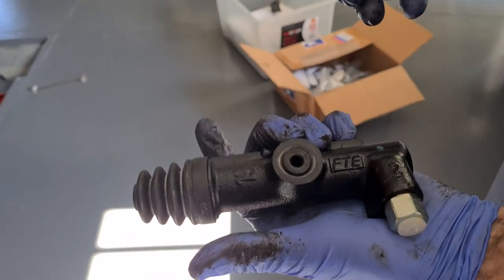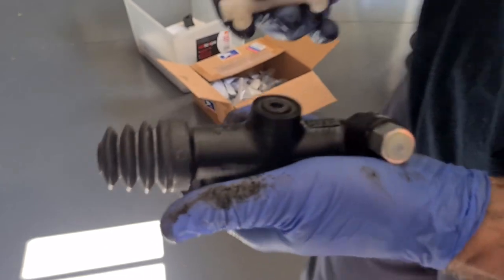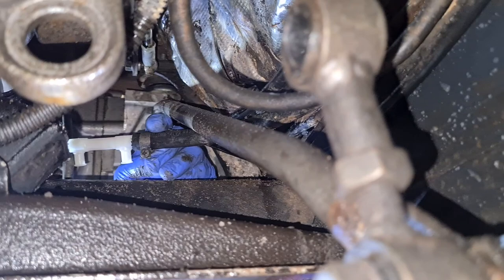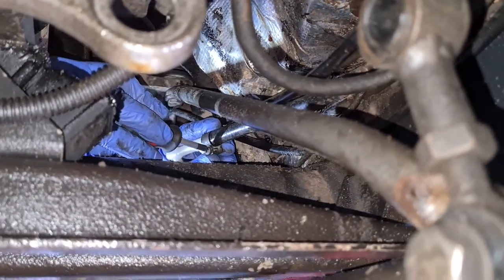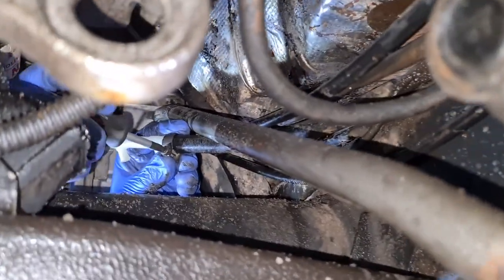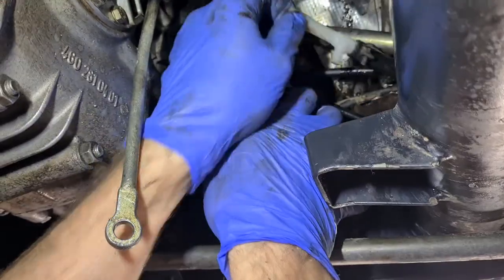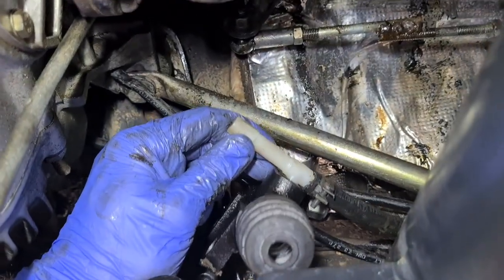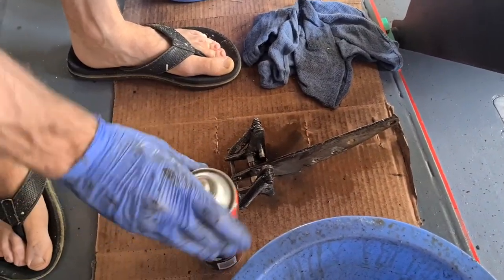You can see where the F-piece goes into that grommet. There's a silvery fitting that needs to be removed if your new one has it, because it did cause me some hiccups — after I put it all in I had to take it out again and take it off before reinstallation. The F-piece is going back on with no major worries, and then the new front master cylinder goes on. Clipping them in is actually a little bit difficult in that limited space — as I said, take that whole bracket off at the start, which makes everything easier.